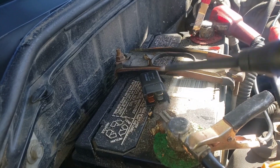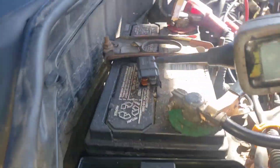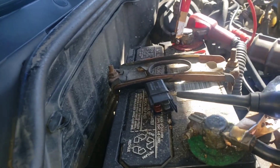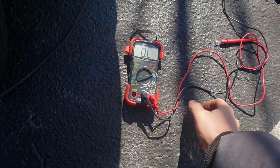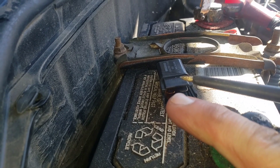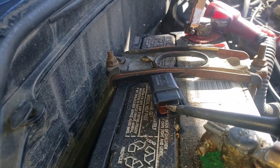I have a video showing you how to check any relay — just search 'Fix Book check relay' and you'll find it. But here's how to do it quickly: take a power probe, hook the negative alligator clip to one of the control sides, and tap the other side to power it — it's going to click. While that is in place, take a digital multimeter, switch it to ohms, and check resistance on the two high-power pins. You want very low resistance — zero or 0.1 ohms. If you're seeing 90, 100, or 200 ohms, there's a problem inside the relay.